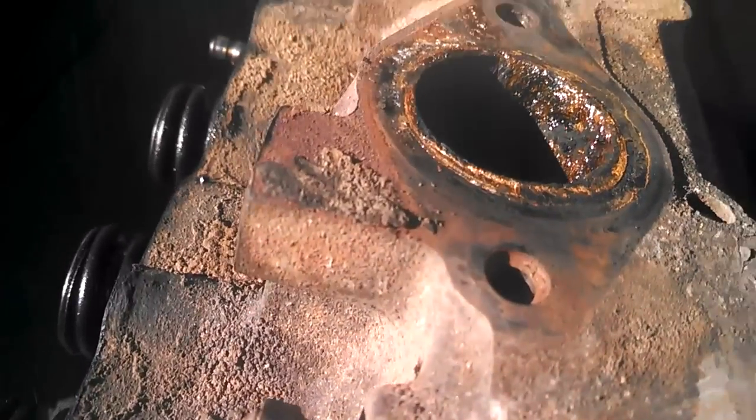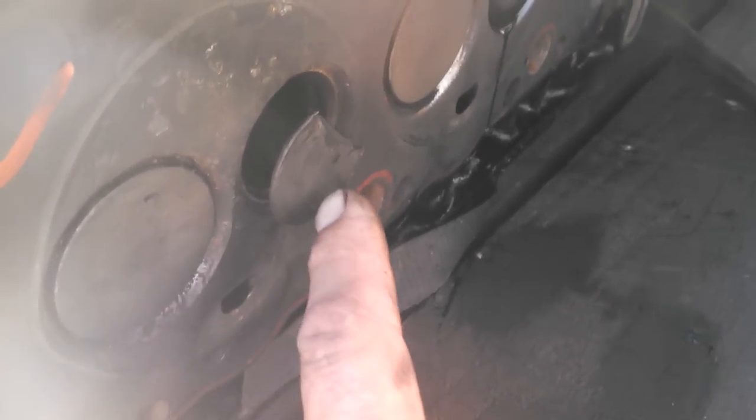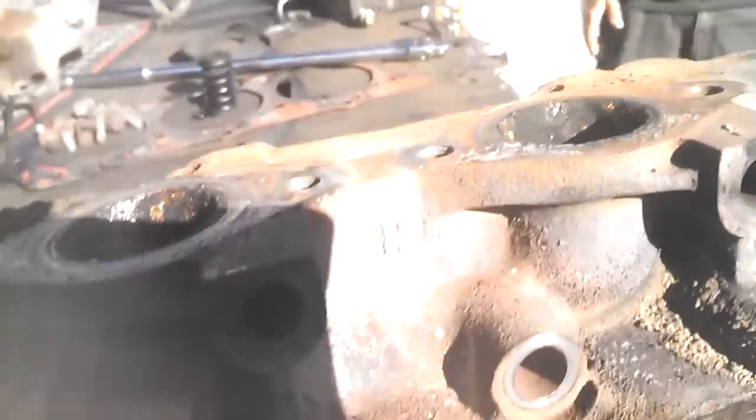I'm getting rust here in the ports, but that's just from cleaning in there. With this much radial play up and down, there's no way that valve can properly make contact. When the valve is open, exhaust gas passes over it — on a proper valve, these edges get really hot, it closes, that heat transfers to the valve seat and cools the valve. But if it's not able to do that properly and it's vibrating in the head, it's going to superheat and cause it to fracture, as you see.